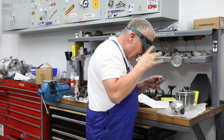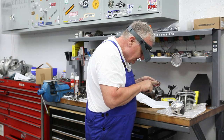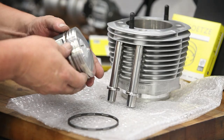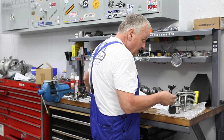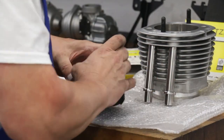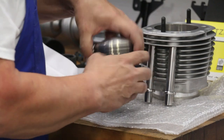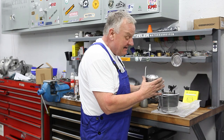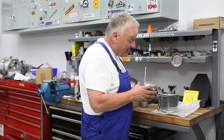It's very small print but you can read it — it says 'top.' Both rings are marked top. To recap: put the rings in the proper order and look very carefully — they are all stamped 'top' and you definitely want to orient them that way.